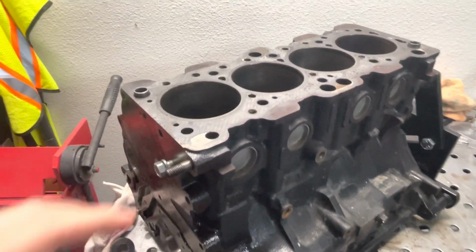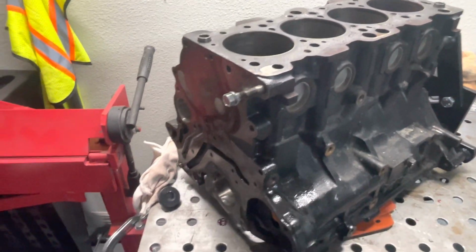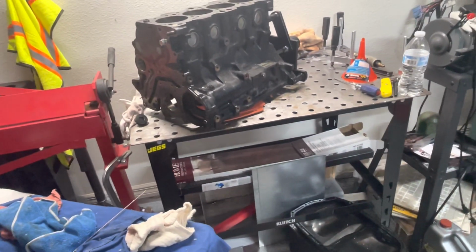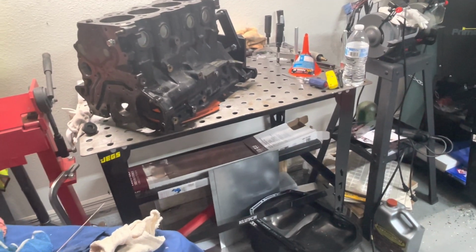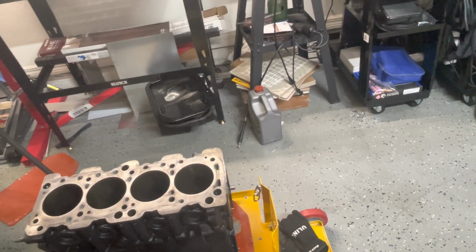So what I did was I washed the block out, I hit it with a little bit of brake clean, washed it out again, and then I put this contraption on it, and then I started filling it. Luckily, I did use cold water because the cold water gave me extra time to work with the concrete before it did set up. The working time on the sheet says anywhere from, I believe it says 30 to 45 minutes. Let's see here. Let me read it real quick.